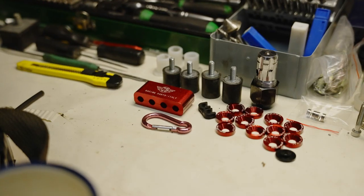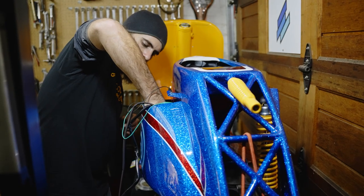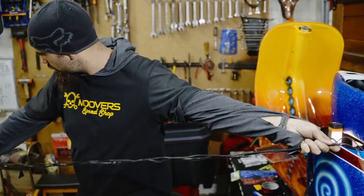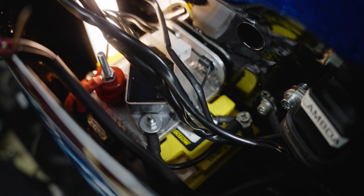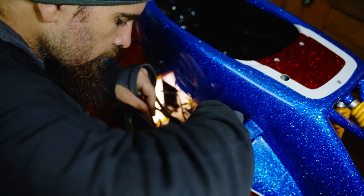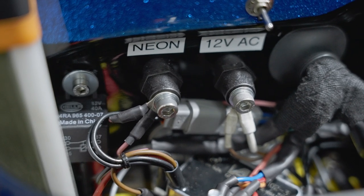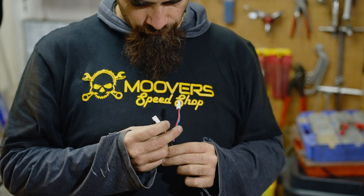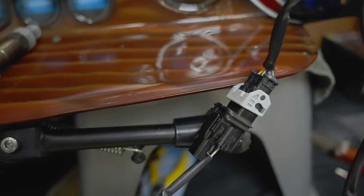The remainder of parts needed to get a rolling chassis sorted out were delivered by Thursday or Friday, which left me with basically a week and a bit to build a completely fresh wiring harness. It took me probably three days to build the wiring loom because we hadn't mapped it out at all. Everything on this bike is DC-fed: a power supply runs from the motor into a regulator, which converts it to DC, charges the battery, and everything runs off the battery. Vespas normally run AC, so this was a completely different setup.